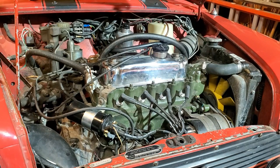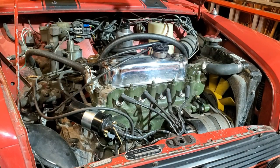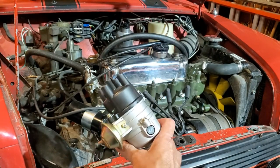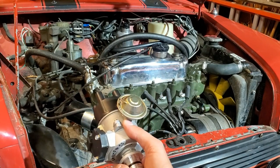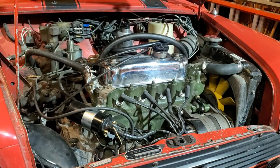One thing I can do is replace the valve stem seals, because I don't know how long they've been on this motor. Even though it was supposedly rebuilt fairly recently, they could be original rubber that the ethanol fuel has degraded. I'm going to start by doing the valve stem seals on all cylinders. I've also finished recurving a new 65D distributor — the old unit only went from 8 to 23 degrees and I want to get it up to 30 — so I'll install that after the seals, then move on to sorting out the carburetor.